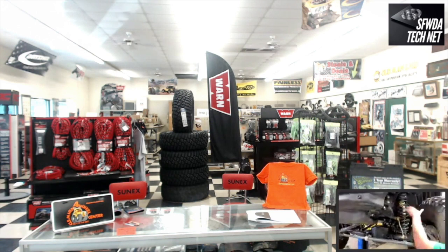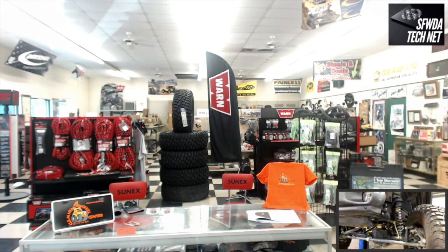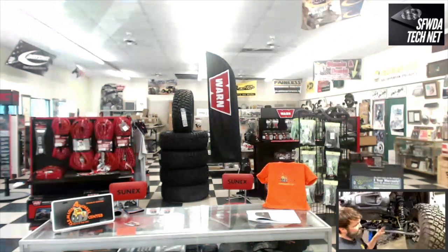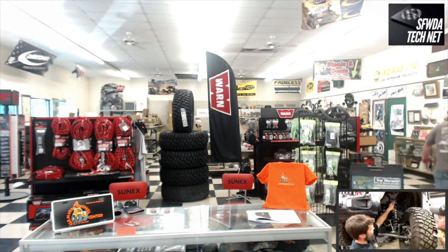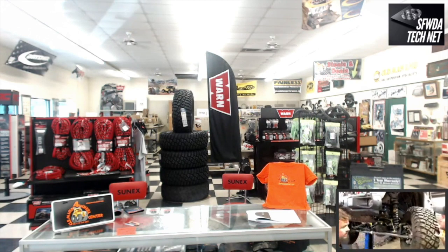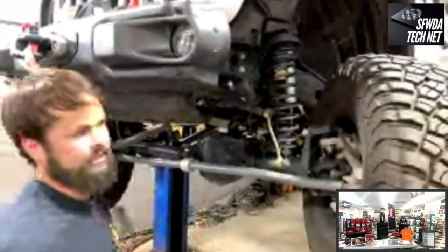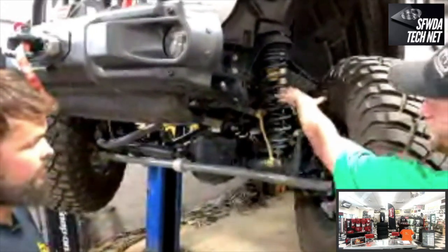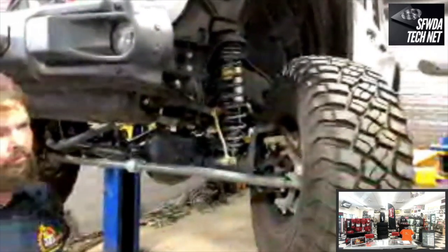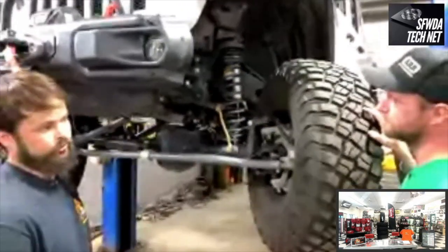There are many different options for bump stops. You can keep the basic setup, or go all the way up to a hydraulic air bump. With the hydraulic option you cut the stock bump off and install a kit that's air-over-hydraulic — you can set it for two or four inches of travel. What it does is slow down compression and ease your ride. Without it, hitting a ditch quickly on the trail gives a more jarring hit at high speed. Air bumps are more suited for high-speed situations like bombing fields or the desert.